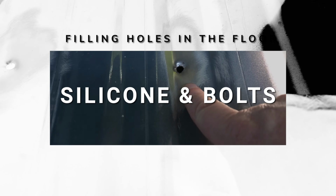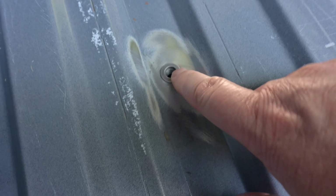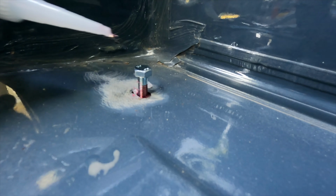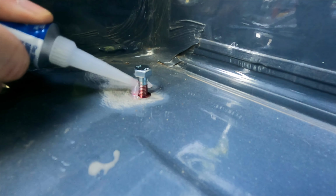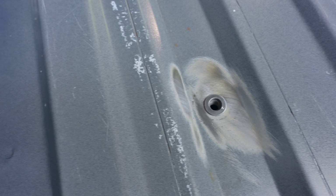So we're putting the lead in these types of holes that go all the way through, but these, the bolts were, we just took the bolts out. So what we'll do is put the bolts back in and put some silicone around it and just tighten them down real tight and maybe some Loctite so they don't come out. And we'll just leave those because if we ever got rid of the van and somebody wanted to use those holes, we don't want to have like leaded them over. So I think that's the best approach.